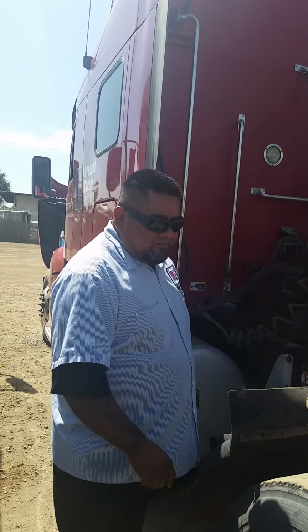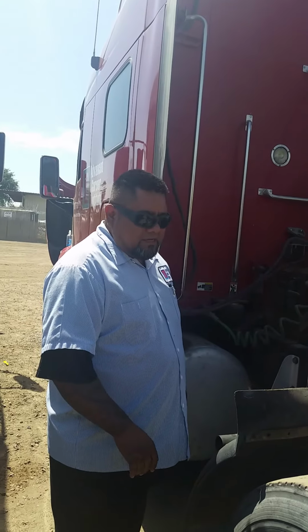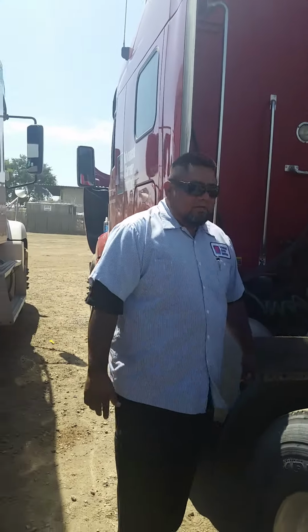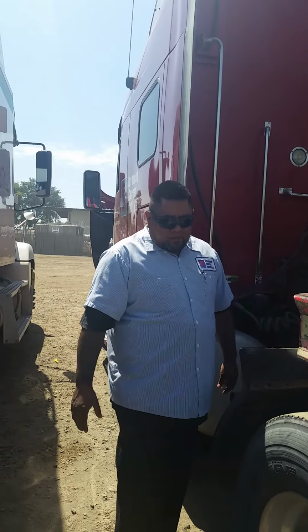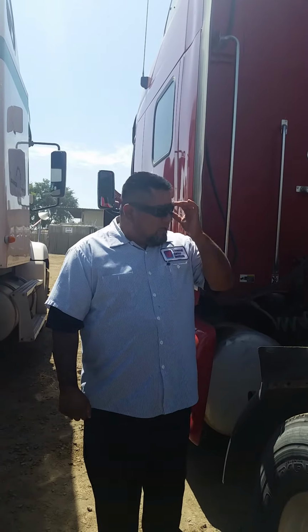My drive tires can be recapped, can be regrooved, but cannot be mismatched. No less than 2/32 of tread depth. I will be checking my rims. These are budd rims. There is no spacer and they are free of debris. I'll be inspecting my axle seal, securely mounted, no cracks, no dents, no leaks, nuts, bolts are present and tight. I'll visually inspect and fill as needed.